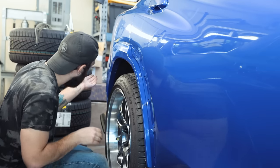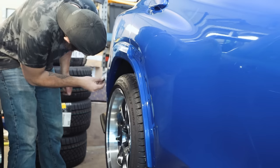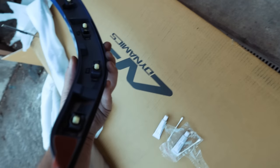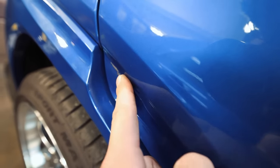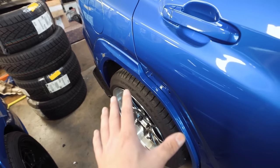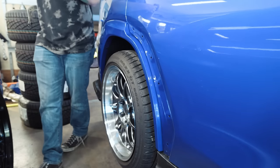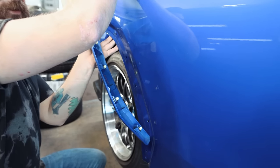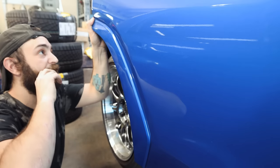You have to open the door to get it started. Everything just fits very well. I'm actually really impressed because normally with aftermarket body panels like this, they never line up well. Now we can do the door piece. On the rear door pieces, Aeroflow does provide adhesion promoter because you do have a piece of 3M tape right there that's going to sit at the top of the door — same thing as OEM. There may be a little bit of 3M tape residue; clean it off, clean that spot with alcohol, put a little bit of adhesion promoter in that area, let it sit for a second and then put the flare piece on. Grab the adhesion promoter, rub it right there in the area, pop the door open, start to line up the clips, and keep pressure on this for a minute so the 3M tape can adhere.